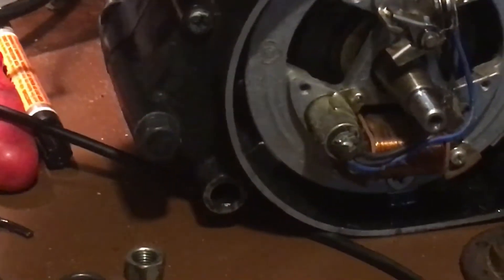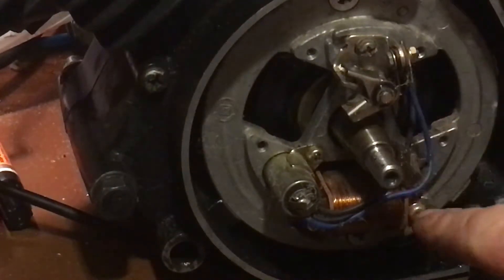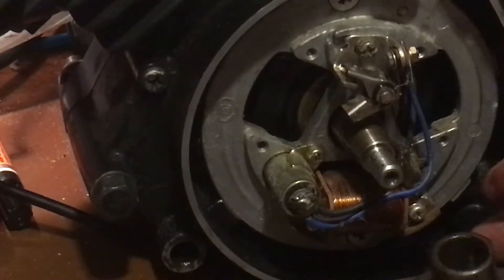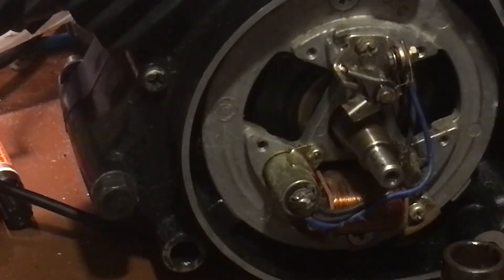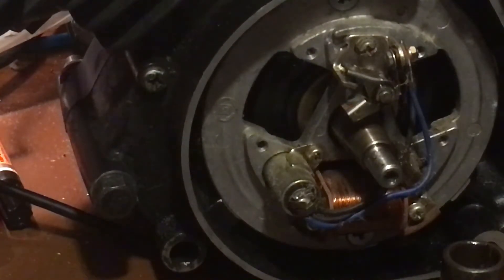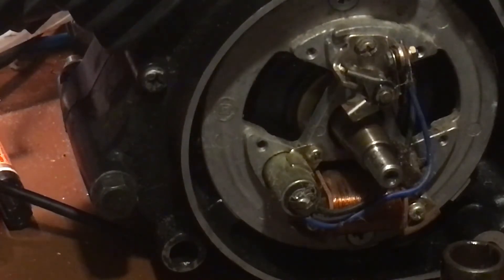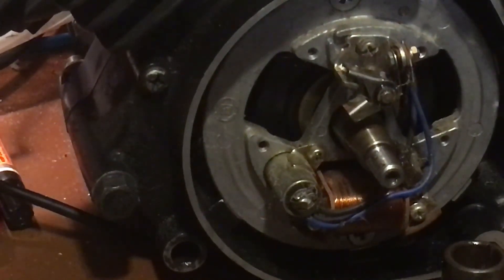Anyway, I figured I'd give you guys a little demo on how that works and what to look for on your points. Make sure you lubricate the felt, make sure there's no pitting on the cam — if you get pitting on that it's not going to work right and you're going to end up replacing your points a few months down the road. I have a separate points adjustment video already up. This is the KE100 motor — the one with the locked-up transmission. That's all I have for you guys for right now. Thank you for watching, please subscribe, and if you have any questions or comments send them my way.